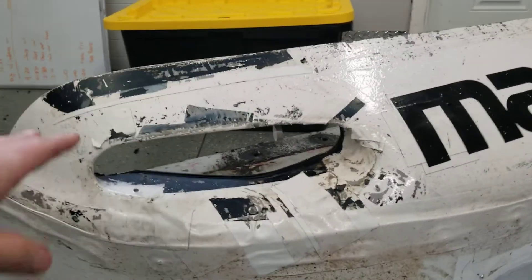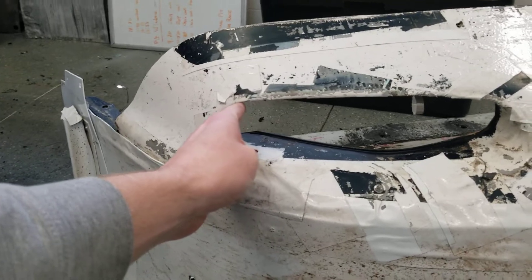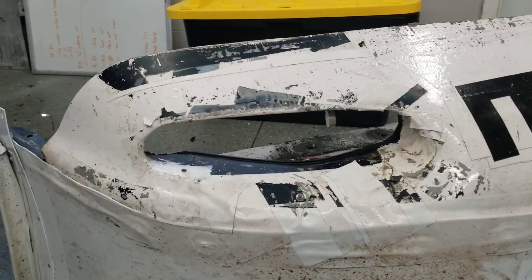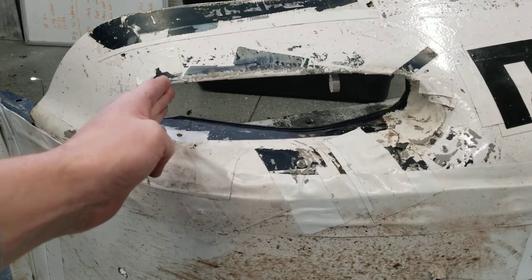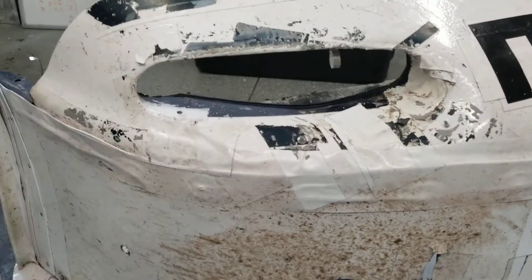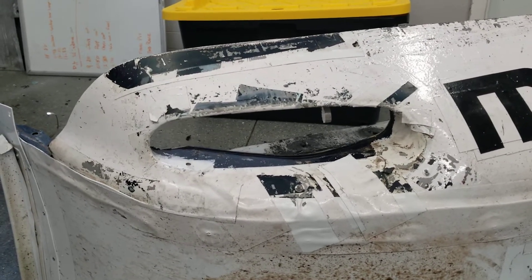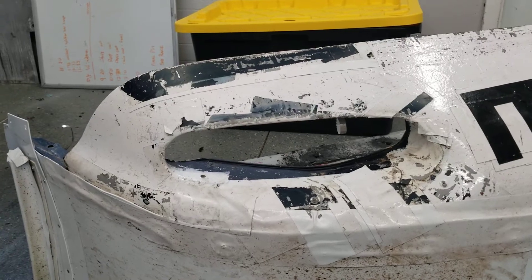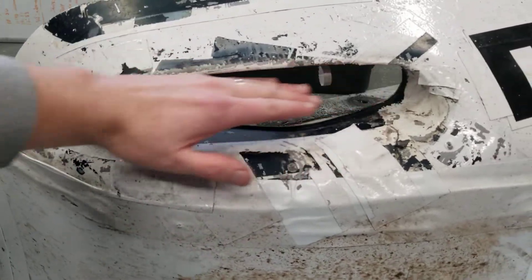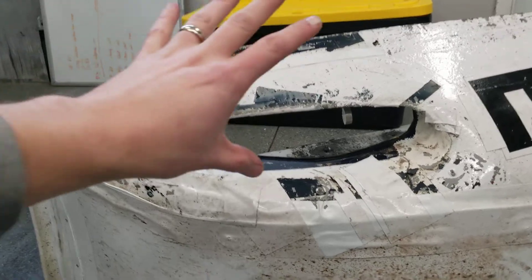A couple of things we've tried on this intake — we've tried various flaps. One thing we heard is that if you put a flap, kind of in the shape of my hand here, it can help channel the air and increase positive pressure, which it does. We did a large flap up top, large flap on the side, small flap on the side, and we did see actual positive pressure differentials in the air box. But it was fractions of a PSI, so small that there wasn't any horsepower difference. I figured the drag generated from those added elements probably outweighed the actual aero performance, so we took those off and we're just leaving it as is.